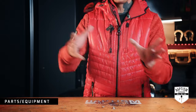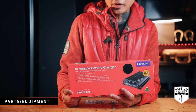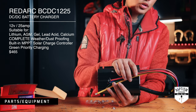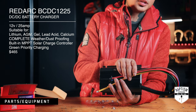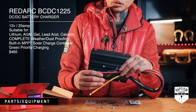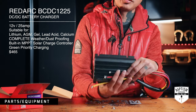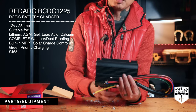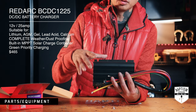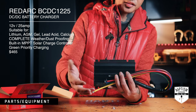To connect your two batteries, we're going with Redarc — the BCDC1225D in-vehicle battery charger. This is a 12-volt, 25-amp DC-to-DC battery charger suitable for pretty much any kind of battery: lithium, AGM, gel, standard lead acid, and even calcium. It is waterproof and dust proof — weatherproof. I'm putting my dual battery in the cargo area of the Jeep so it won't be exposed to elements. But for those of you that want to put your secondary battery in the engine bay, you want the BCDC as close to your secondary battery as possible and it should be protected from water crossings and dust.